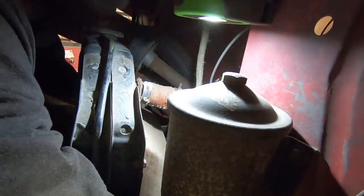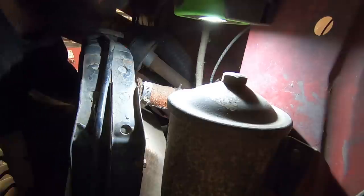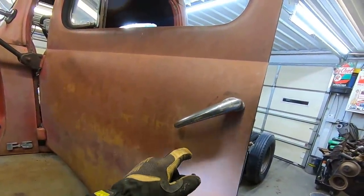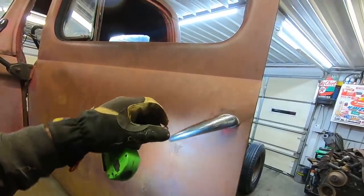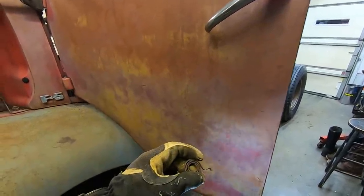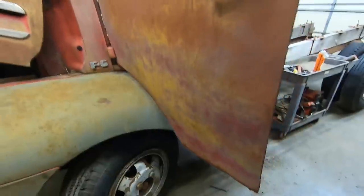See what we can see in there. Maybe put some lubidoob in there. Let's just get out of here. Oh, look, the door spring. So this is the spring that goes on the back side of these handles. So every time you're at a car show and you see a guy with a really nice painted car and his handles are sitting like that, instead of sitting horizontal, it's because that spring's busted. More worthless knowledge for you. They're kind of a bugger to put in. Probably why nobody ever fixes them.